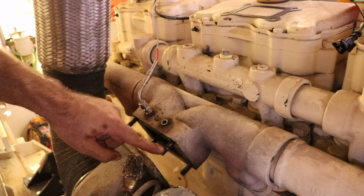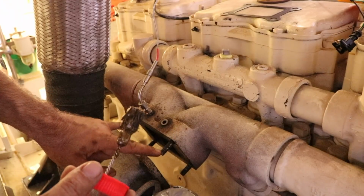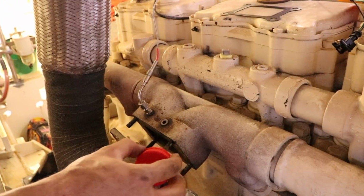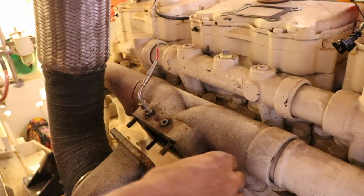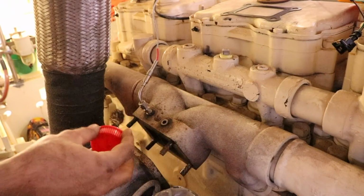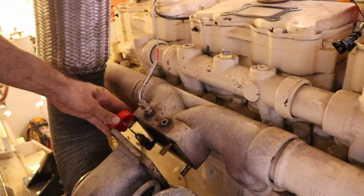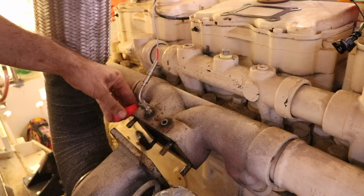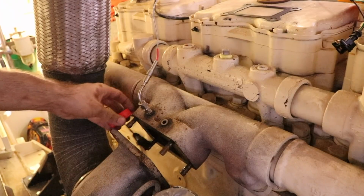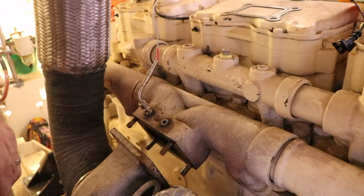So when you go to put exhaust studs back together, always use copper coat, because exhaust studs are meticulously designed to seize and break at inopportune moments. And these ones particularly so, given that they're garbage. So plenty of this. Well, I call it copper coat. That's only a brand name. It's anti-seize, whatever it's called in your part of the world. Really doesn't matter, just so long as it's something that can handle high temp, and is not going to dry on you. You want it to remain liquid so that in 5 years' time you can undo your exhaust manifold.